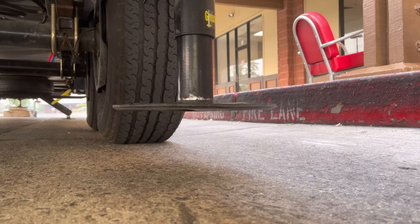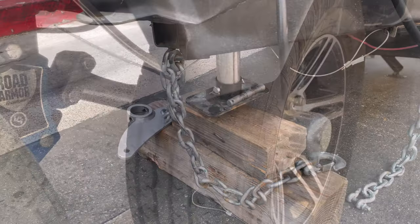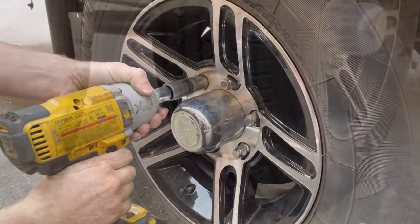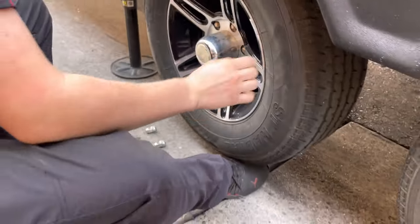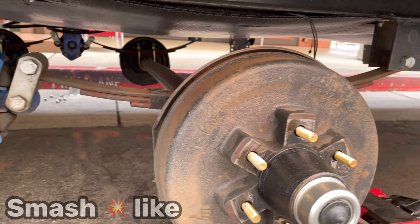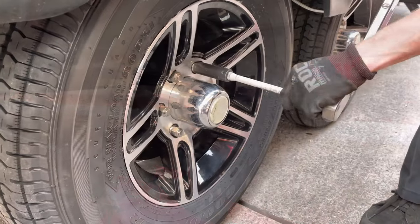One thing I did when getting my trailer ready is I put down the leveling stands, because I've seen the drop post get damaged before from tire shops — it's rare, but it happens. If you notice my tires, you can actually see the tread pattern and wear pattern — all four of them look great. Those Trailer Kings did really well; I was surprised, with over 7,000 miles on them they still looked great. This is also a great time to do an inspection while all the tires are off — you can check the leaf springs, the mounts, and the brackets that hold the leaf springs on for weld point failures and other things.